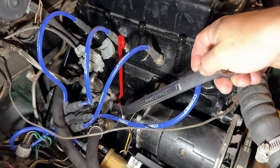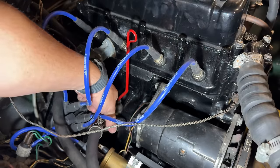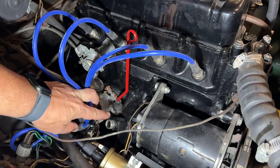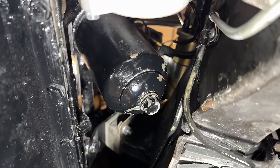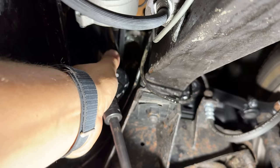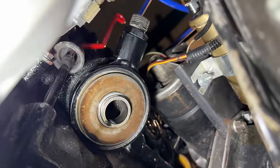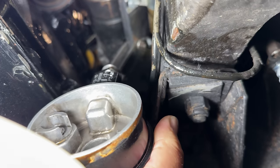You need a one inch wrench to get this loose. Now that that hose is removed, I'll get the car up in the air. Now that we're under the car, just in front of the starter, this black canister is the oil filter. It comes off with just the one bolt on the bottom. Right now I've only removed the oil filter canister. I also have to remove this oil filter adapter that has the fitting for the oil cooler on it. That should just pull right off — it's only held on because it's been on there for so long.